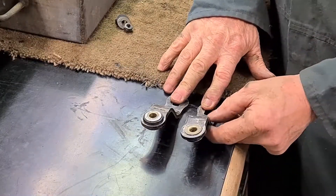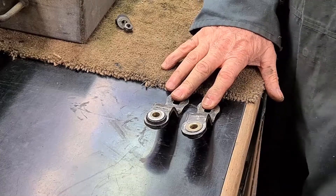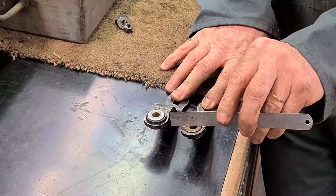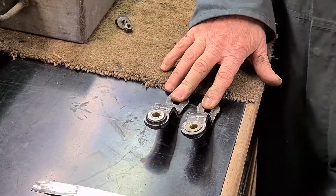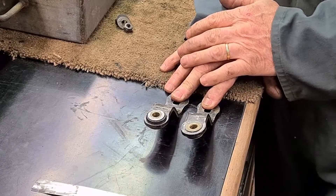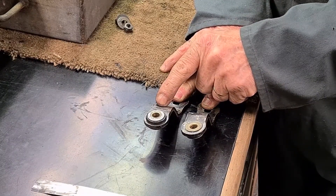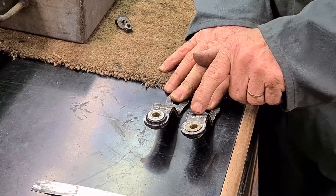You can see that being pushed across - that's how they've done it. It's a nice way of locating it, but you're going to get more wear on this because later gearboxes didn't have this type. I've been reading a book and they mentioned a difference on these two levers - this one has more of an angle than this one. The one towards the back of the gearbox for first and reverse is part number 7291, and the one towards the front is 7286.